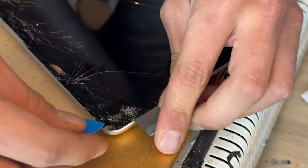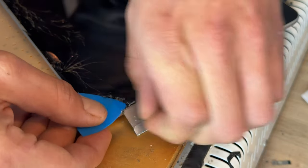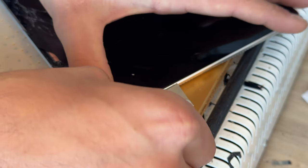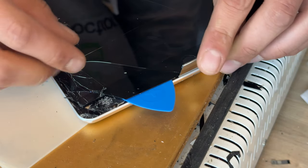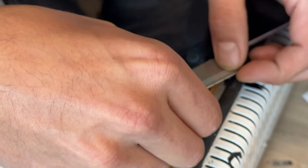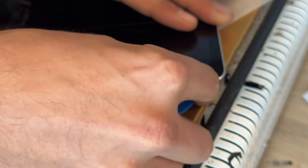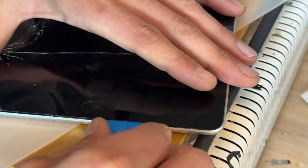It's important to note that the adhesive is a little bit thicker down the bottom edge, but if you're using a heat mat it should be plenty warm enough. However, if you do find there is any resistance, you can just add a couple of drops of isopropyl alcohol along the edge and then go back with the guitar pick, prying upwards. When you're around the home button, be really careful not to insert the pick far at all, because there is a risk you'll cut the flex cable for the home button. If that happens, it will render Touch ID obsolete. Just a couple of millimetres with the pick here, nice and steady — we're just aiming to separate the adhesive from the chassis.